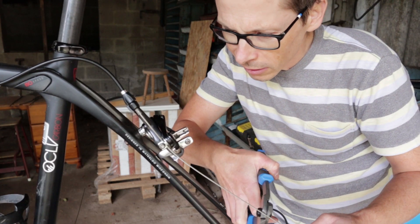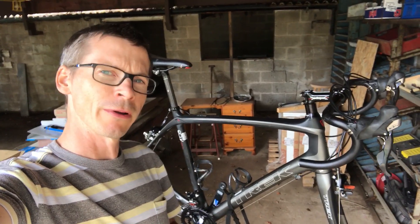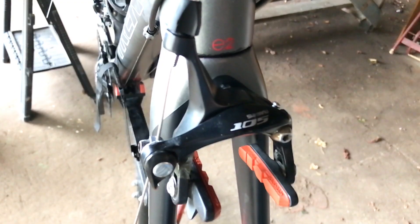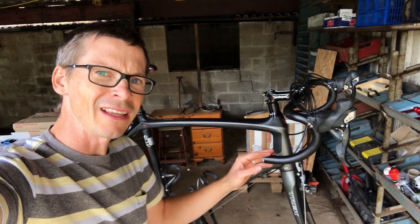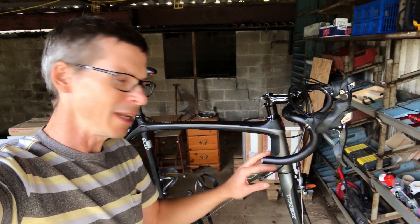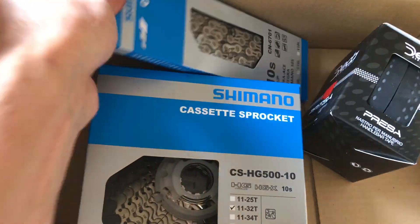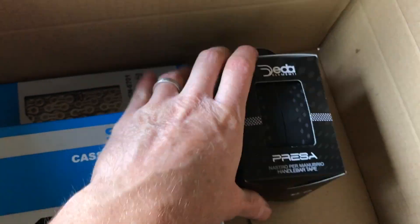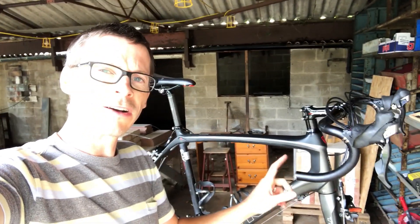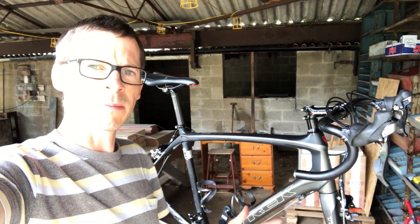Quickly chopped this cable just before the battery dies on this camera. I think we'll leave it there for today's video — made reasonable progress. Managed to install the gear cables, the brake cables, removed the bar tape, and so far it looks as if it's all working. In the next video, we're down to only a few items in my box of tricks: I think there's a cassette, a new chain, and the new bar tape. Once we take those on, then it's just a case of finishing off and this bike might be rideable.